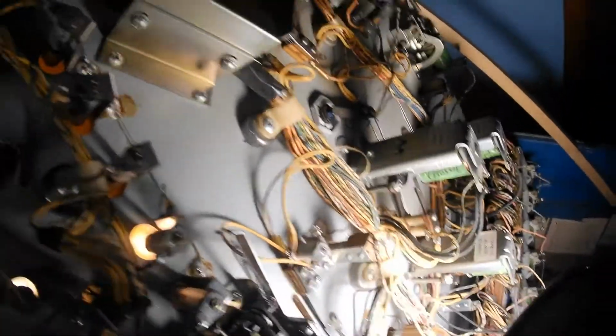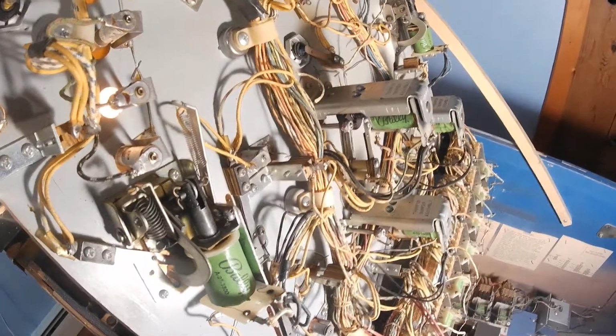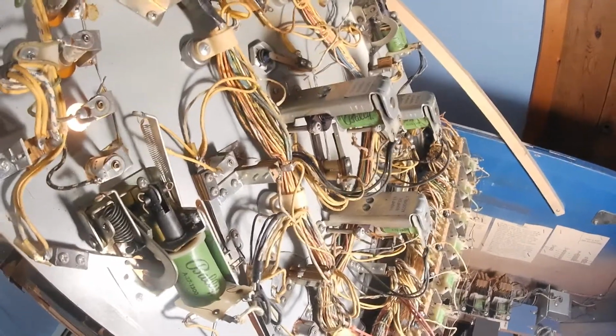Anyway, so I went through all of those that are marked with a blue and white, a white wire with a blue trace. They all look good, and then I said, darn, maybe there's something shorting out in the back. So what I did then was I looked on a schematic, at these Jones plugs in the back here, and the Jones plugs here in the back box. It has to come back here in the back box because this is where the relay is on top.